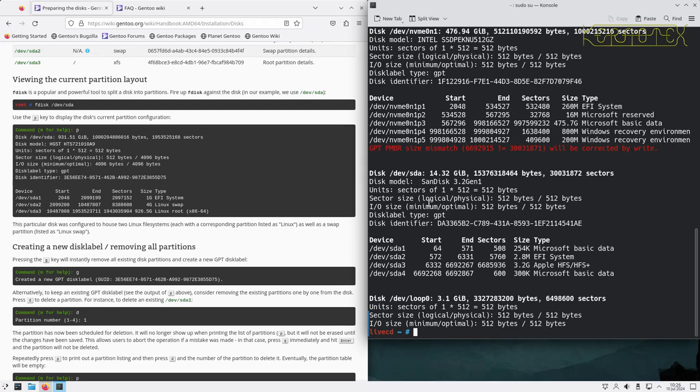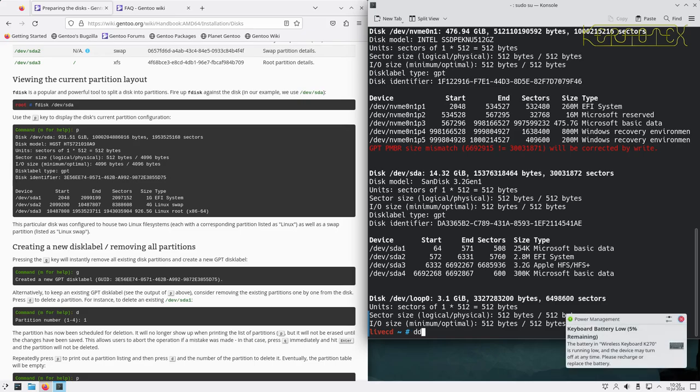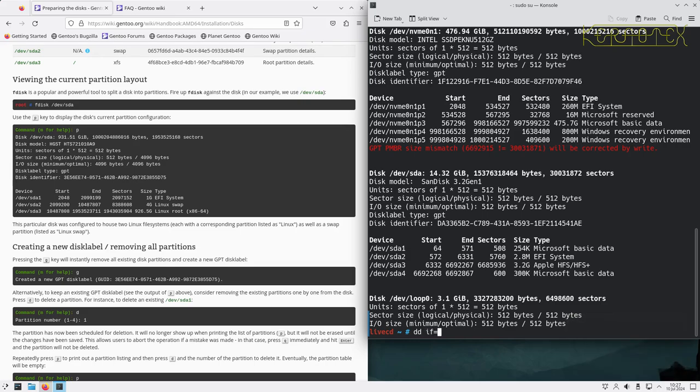One thing I'll show you — you may want to erase the disk first. With a traditional spinning disk you can use dd: 'dd if=/dev/zero of=/dev/sdz bs=64k status=progress' — that writes zeros to every sector. This is absolutely not recommended for solid-state devices because you'll end up wearing out the disk more quickly than necessary.